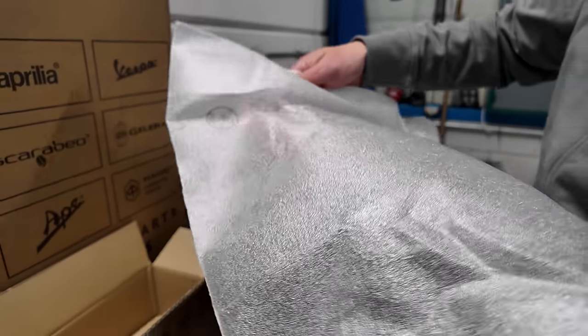If you're hooking up the battery, do the positive first and the negative later. Because if I hook up the negative and I'm working on the positive and I hit the frame, then you get... kablamo.